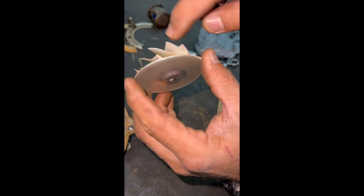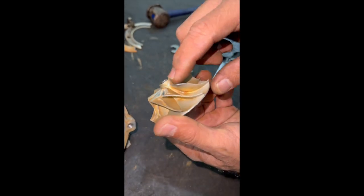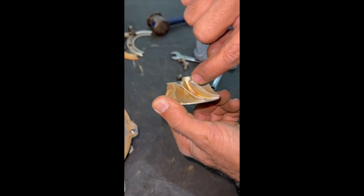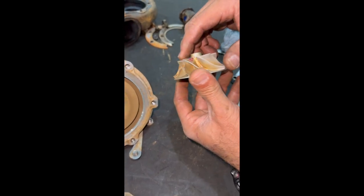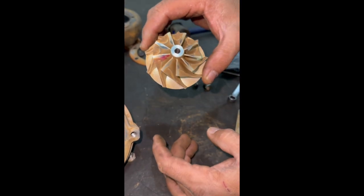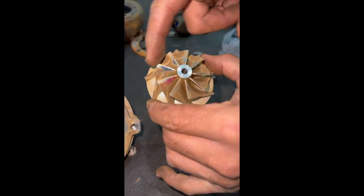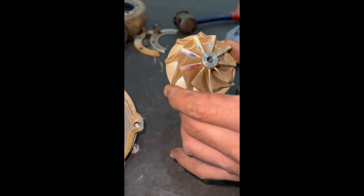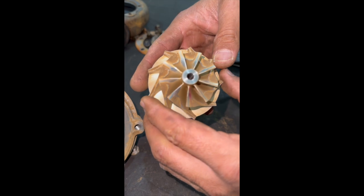That's why the leading edge of these blades are not actually damaged. The underside you can clearly see has been sandblasted. The compressor wheel is still intact. The contact or blasting between the edge of the blade and the housing has caused a little bit of wear, but usually what you'd find when a compressor wheel is exposed to dust ingestion is the edge of these blades where the corner sits actually starts to round.